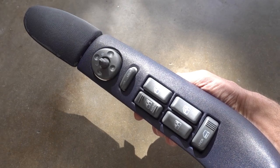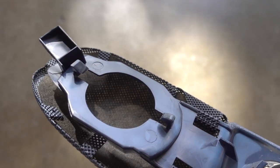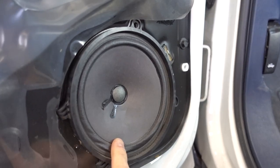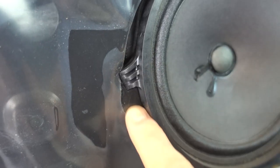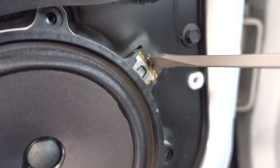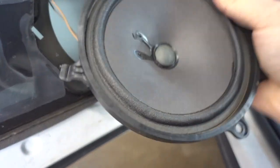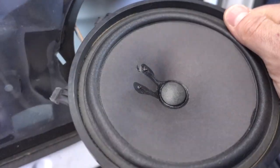You can see on this control panel where the tweeter was, and if we look underneath you can see the space that the original tweeter sat. We're going to install it in the exact same position using the parts included in the box. Now for the woofer — interestingly it's actually not screwed in. There are provisions for screws but they didn't use them; instead they have these little clips. Right up top there's a little clip and all you do is grab a screwdriver, press it in and pry it out — just like that. Now this whole speaker rotates out, and here you can see the back of the original factory speaker on this '95 Suburban. Wow, this thing is garbage.